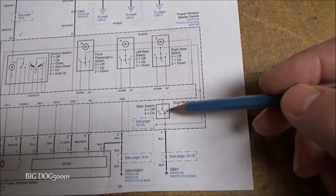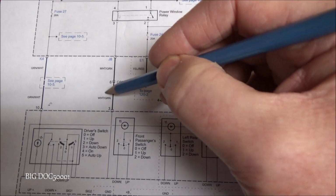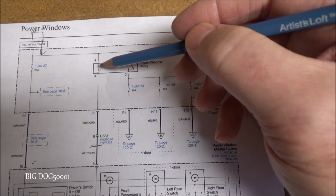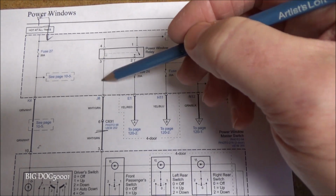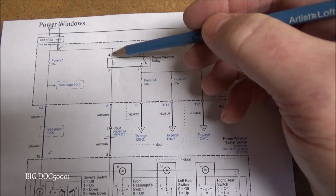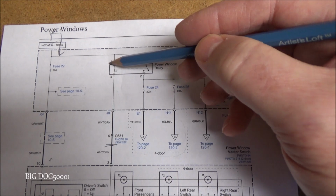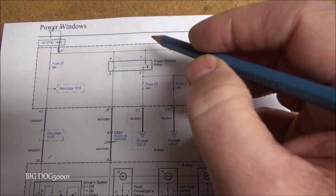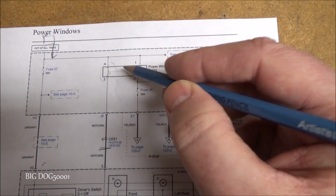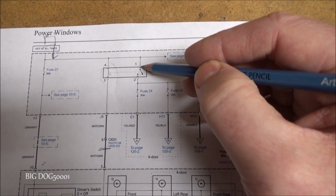So when you press your main on and off switch, when you turn it off, what you're doing is cutting the ground right here. Because if you didn't know, as power comes in, we've got this coil of wire right here, and when this leg is grounded, it energizes this coil of wire, sends power through it, and anytime you have a coil of wire with energy flowing through it, you create a magnetic field. So this creates a magnetic field around here, and then this switch right here is metal. And so once this magnetic field is created, it attracts this metal switch, which closes. And once that closes, it allows power to flow through right here.